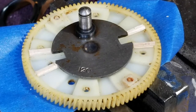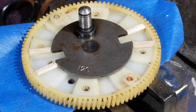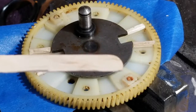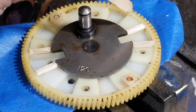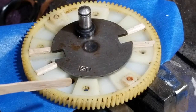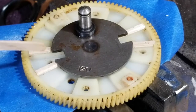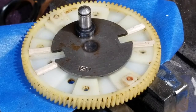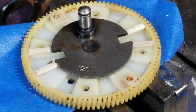And there we go. I have the JB Weld kit, and I'm about to mix some up here. In comes a stir stick. I've cut that in half, or quarters or thirds, and you can see where I've placed dams, for lack of a better word, barriers. And again, I want that JB Weld to fill all the way up, go into the holes, both sides there and there, and all the way up so that it grabs into this little keyhole area. I'm going to strategically pause while I mix up the JB Weld, and I'll get it going here in a sec.